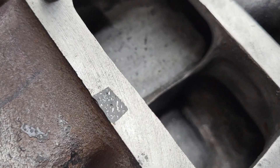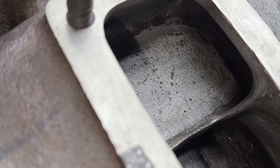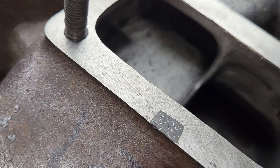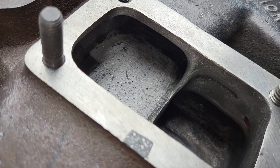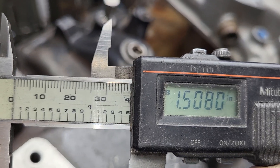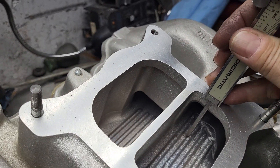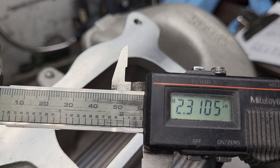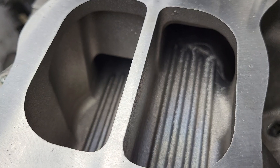The stocker two-barrel is horrendously low-rise. I actually made a hole in the high plenum trying to get more area. Measuring it now — the epoxy is very thin right there — it's only 1.5 inches deep to the upper plenum. Let's compare that to the Weiand Stealth. Huge difference. Massive difference. Plenum volume equals power, guys. It's very important. The engine sees a decent plenum, and it also aids in the mixing of fuel.